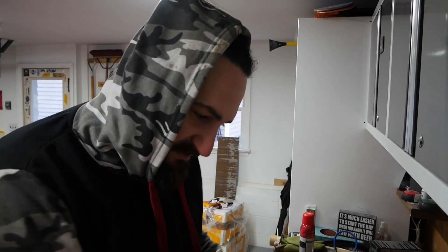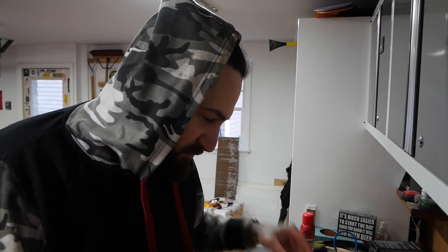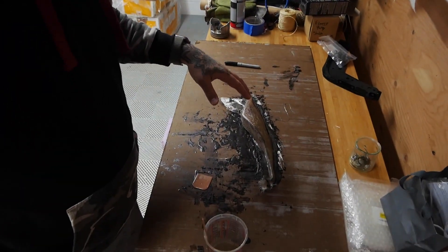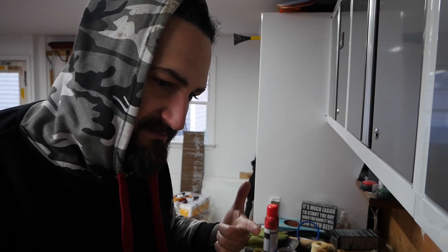Since it's not completely hard yet and I don't want to try to release it from the wood, I'm going to leave it. Fiberglassing doesn't seem too hard, but I think you need to do it in the right temperature to get it to actually harden. It's been about 20 hours and it's still a little sticky — it's not supposed to be sticky. Also, I probably should have put tape down on the wood first before I did this, so I could actually pull the whole piece off.